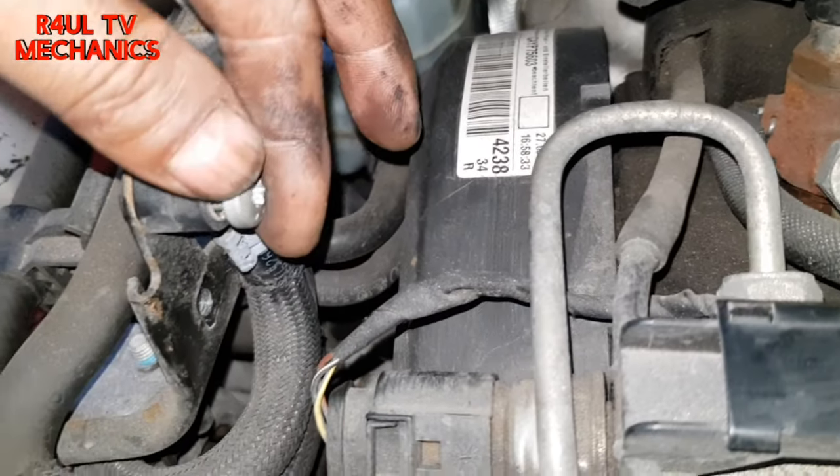We've took the pipe off here as well — that goes into the DPF as well. So basically what we're going to do now is put some product down there, some DPF cleaner. You can buy it from your local shops. I'm going to use this DPF cleaning spray — spray it through the DPF filter to regenerate it. As you can see: fast and effective cleaning, no dismantling of DPF, extended service life, cleans soot and carbon deposits. For the sake of 20-25 quid, you might as well try that before you take the whole thing off and spend like eight hours on it.